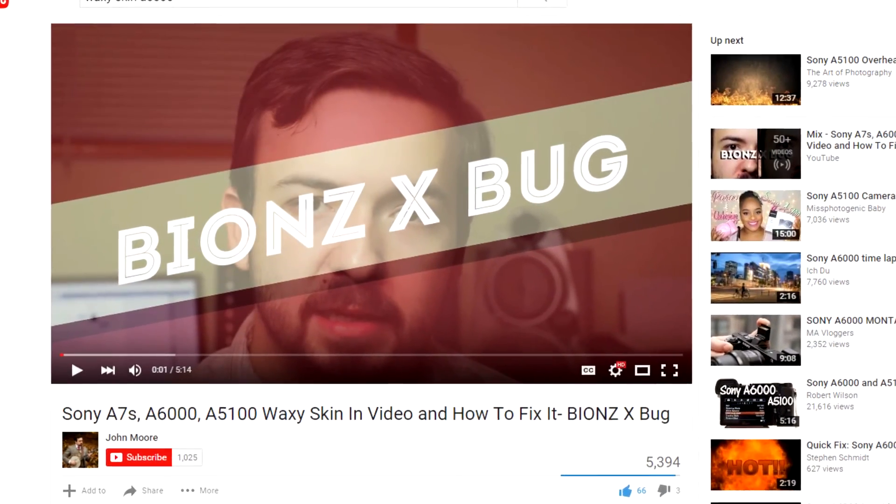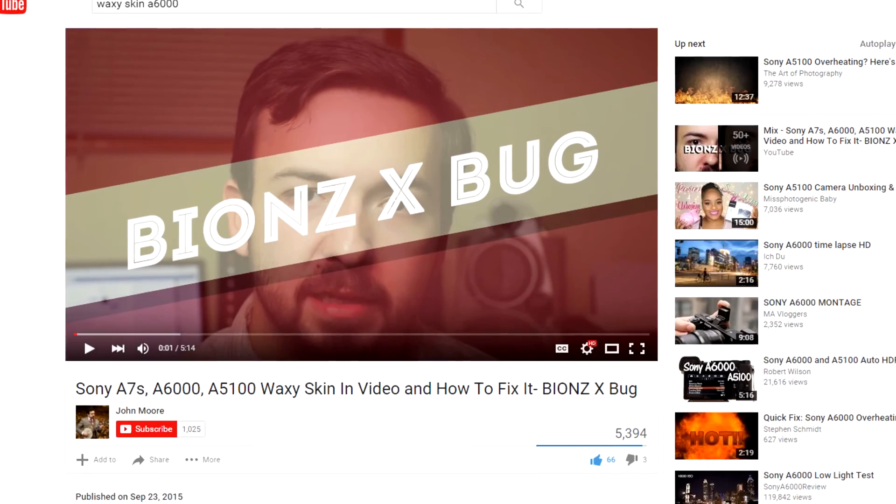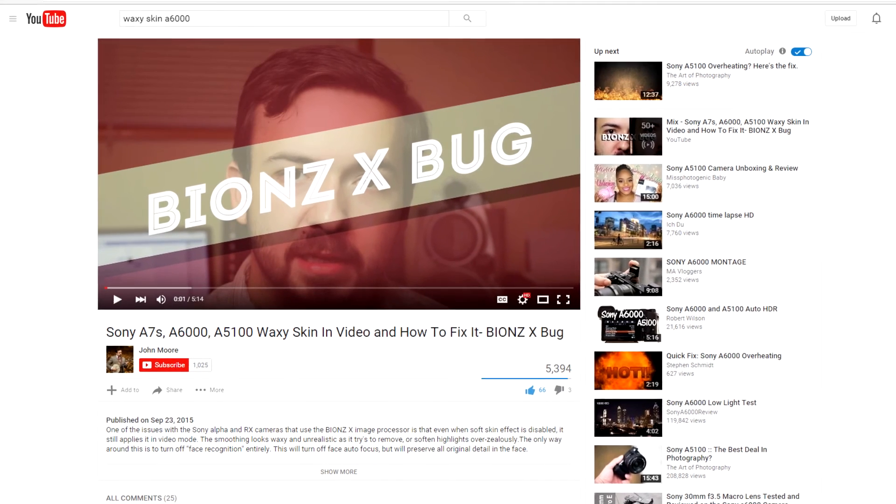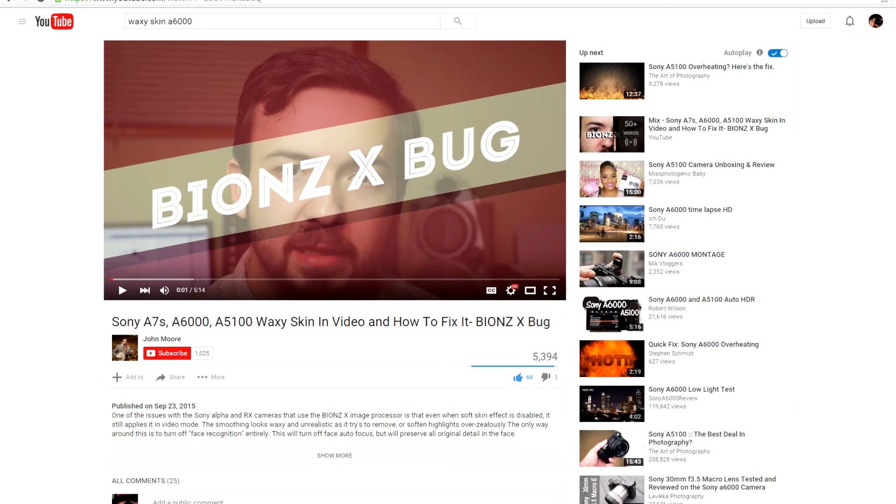John Moore has a YouTube video demonstrating this problem with his A6000, and his suggested solution is to just press the record button on the camera while you have the HDMI device connected. You'll get your higher quality video with the 422 color and better compression, and the camera will also be recording its own backup copy. There are a couple of reasons why this isn't really a solution. Number one, all these Sony cameras — aside from the A7S for different reasons — will overheat. They're not designed for heat dissipation. The A5100, which is the one I'm using here, is actually one of the biggest offenders because it's such a small body, there's nowhere for the heat to go.